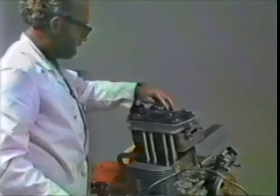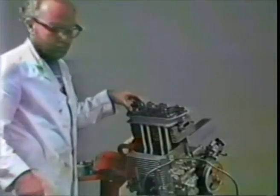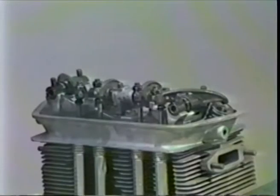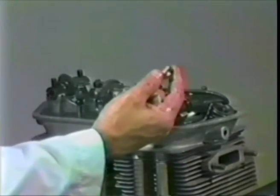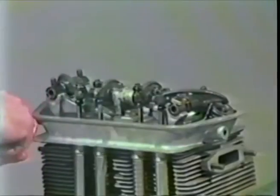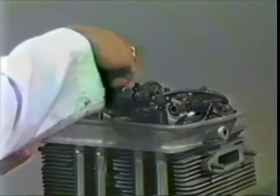Okay, now we go and get the saddle washers, the special saddle washers to fit over the intake rocker stand and the stand here, and the special nuts, and I'll show you them. Be here in a second. Okay, take the special saddle shape washer, put over the rocker arms like so. There are 6 of these special saddle shape washers on each side, 12 total.